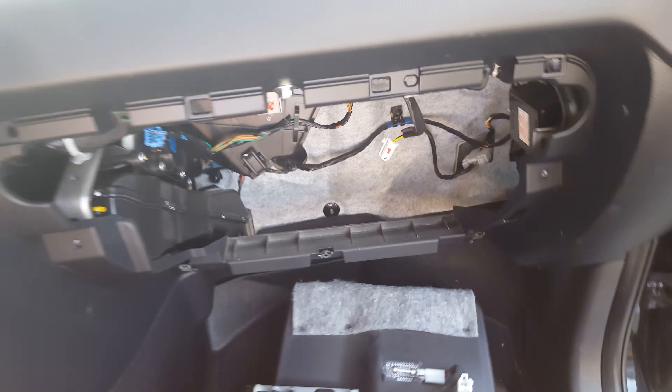I've already got my glove box taken out, but you'll have eight screws total — three on the bottom, one here, one here, one here — those are the ones on the bottom. Then you'll have a screw here, two screws on the top over here and over here, lined up in here. And you'll have one actually inside when you open up the glove box lid, right in the back inside the glove box. Once you've got all eight screws — they're Phillips head — gently pull on the lid; it's just mounted on by clips, so just kind of gently pull out towards you.